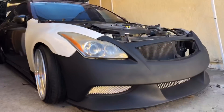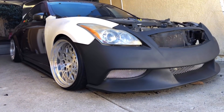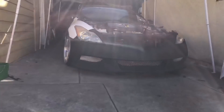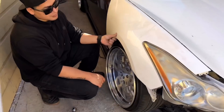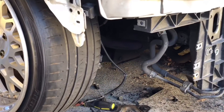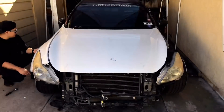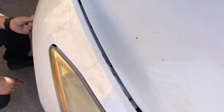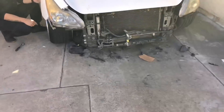That is a sight to see. I adjusted the wheel so it pokes out but the car is sitting way too high, so we're going to adjust these brackets and have this thing sit a little further down. We were able to line the hood up perfectly, and the fender kind of lines up — I need to re-bolt the headlight but once it's bolted on the fender should line up with it. We're a little stuck on exactly what to do next. We still have to lower the whole radiator support.